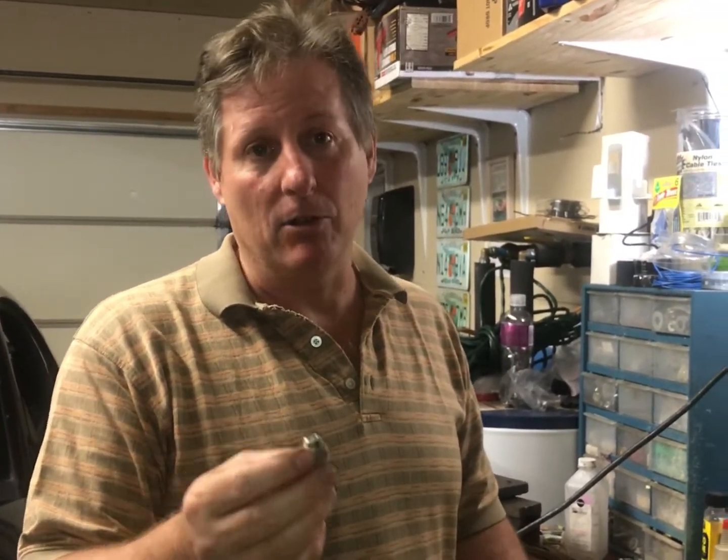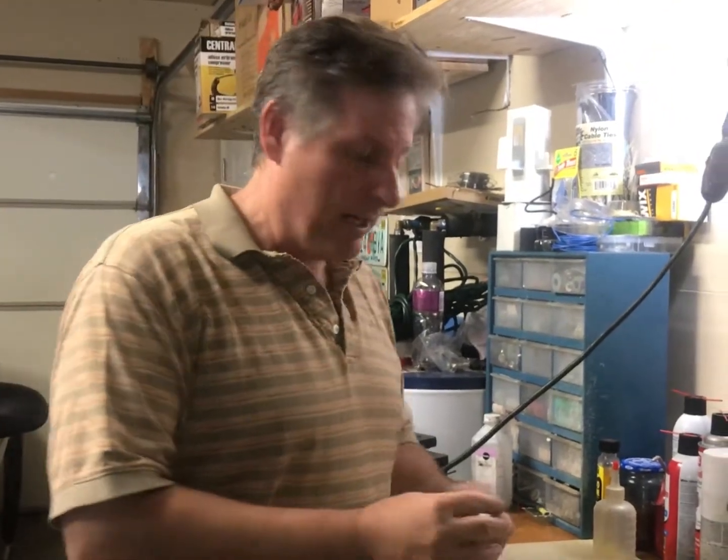The whole point of having the drain is to be able to get two or three quarts out every other oil change, or every 15 or 20,000 miles. All the Japanese cars have them, and I've taken full advantage of that. Our Odyssey and our Maxima has had three to four quarts bled out about every 15 or 20,000 miles, and the Maxima has 173,000 miles and counting. The van has close to 160 on it and we've never really had any transmission problems.